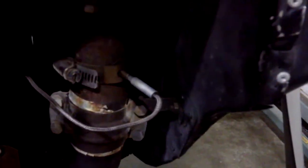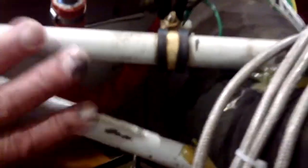If we get some time, we're also going to be addressing this rampant exhaust leak on all these bead clamps on this airplane while we're here. As long as the electronic ignition system is going in, it looks like the coil pack is going to get mounted right here on the motor mount. Though it looks like we have real estate on the firewall on both sides, we do not — this side has a fan for cooling the avionics, and on the other side there's another device already hooked up.